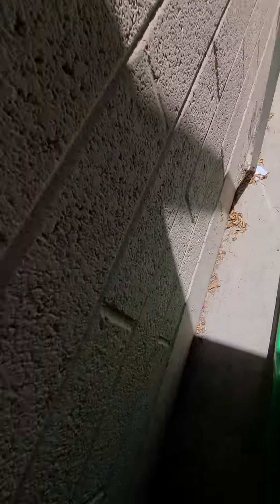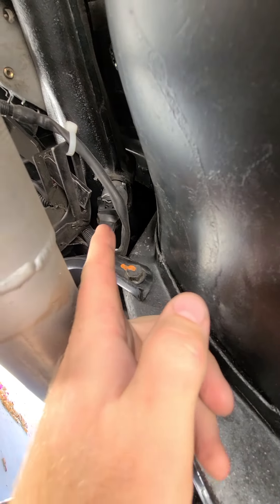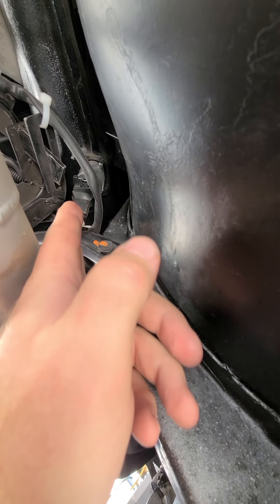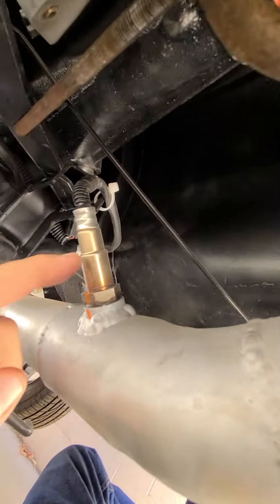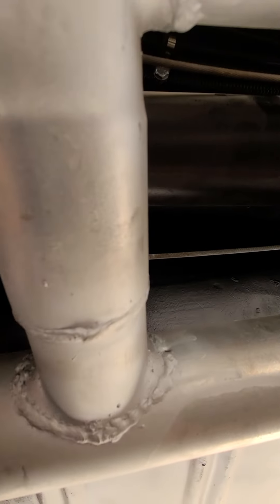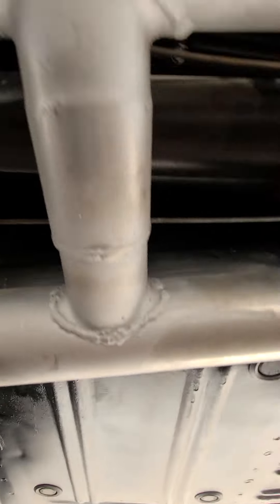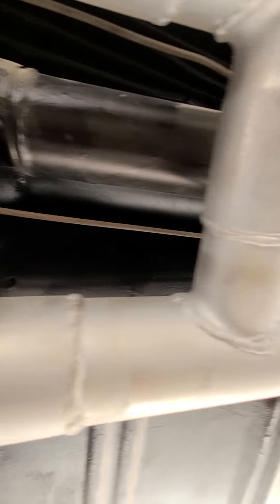Give this a look-see underneath here - let's see what it looks like with it all zoomed out. The speedo output signal generator had to be wired into power. Here's the O2 sensor - it's back off of this bank here, before the H-pipe. We put our e-brake cables in, it works really good - put the spring on. I greased all the u-joints because I hadn't done that yet.